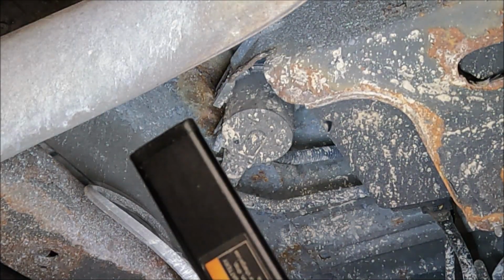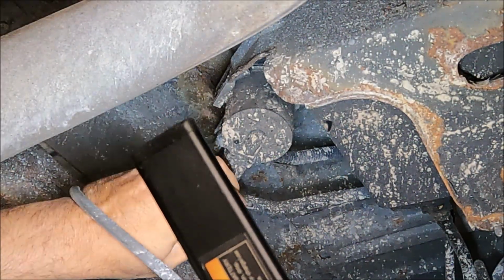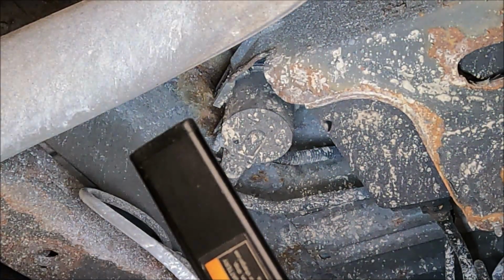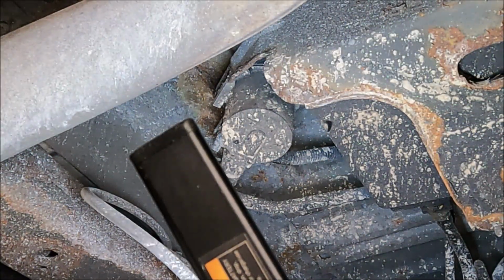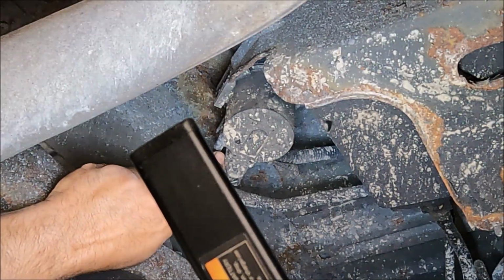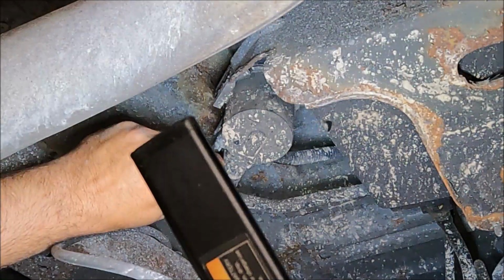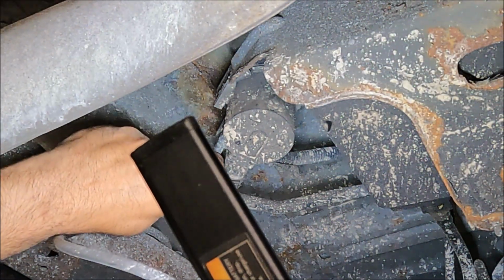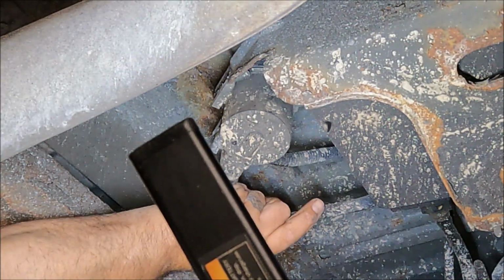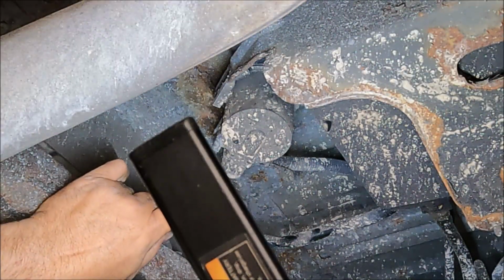All right, so a little pocket screwdriver. I grabbed a little flat blade screwdriver. You can work in there. Get the one side down. Now I'll come up with a pick on the other side. Try to get it right past the lock. And it pulls off like that. Right, it's the little tabs on this fitting here are grabbing onto that part there.